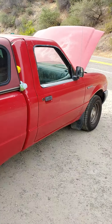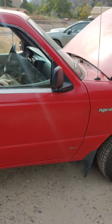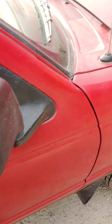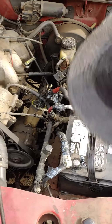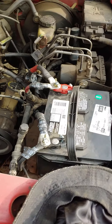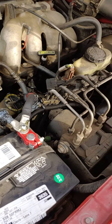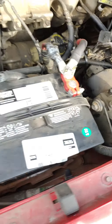It is a 2001 Ford Ranger — nothing special, it's a five speed. The first mod I did to the vehicle was putting in special terminal posts for the battery so I could hook on more than one negative and positive. I have the negative cable running all the way underneath the cab, and the positive cable goes to a 200 amp fuse — both leading directly under the vehicle.